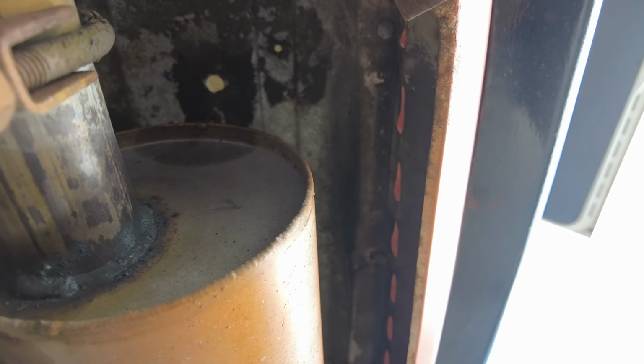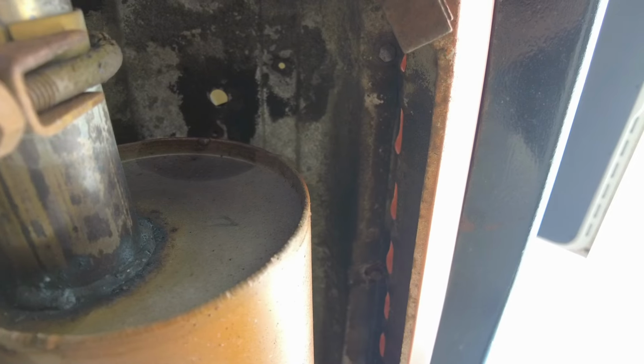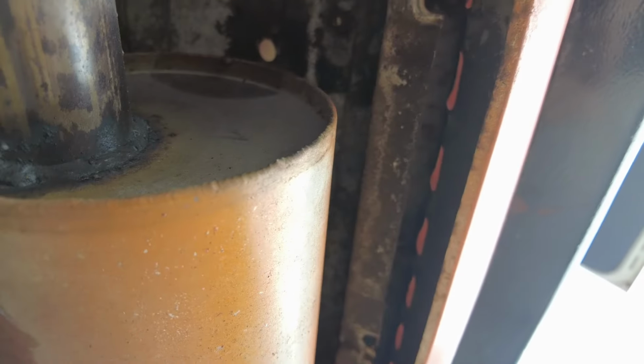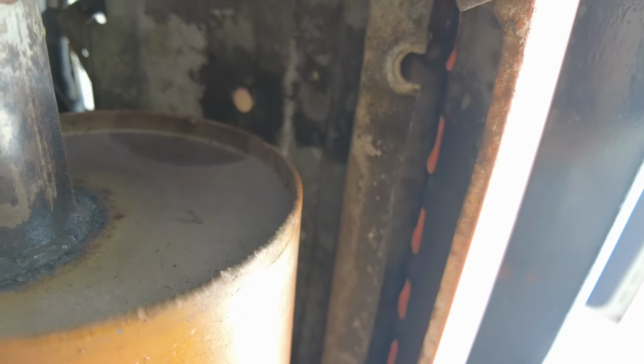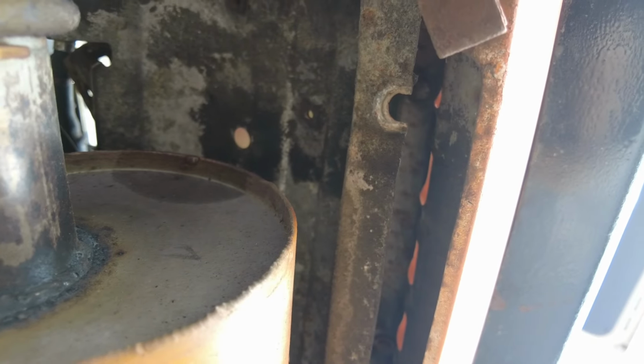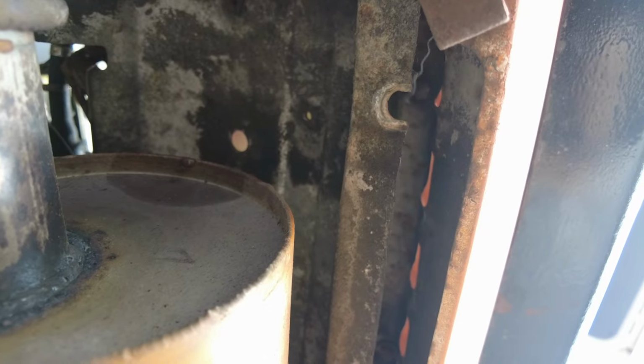As always I forgot something. Up there on the back shield is a couple of 10mm bolts I forgot to remove. So that's why the engine came down at a funny angle. Unfortunately, neither of the two bolts wanted to come out, they're just spinning. Thankfully though, the plate is actually slotted rather than holes to attach, so I managed to loosen them enough to slot it out, but I'm going to have to address that before it comes back together again, because it will be a nightmare to get the plate back on if I can't get the bolts out.